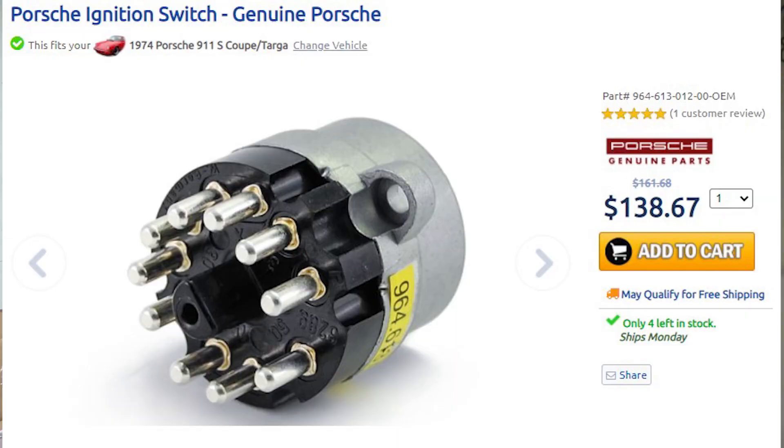Versus if you had to change an ignition switch, they're hundreds of dollars and availability is not so great. If your wiring is in bad shape, the relay isn't a good solution — you've got to fix the wiring. You want your ignition switch to be functional, but this will just prevent it from failing electrically, and it might extend it like another 10 years or whatever that may be.